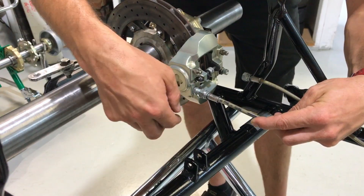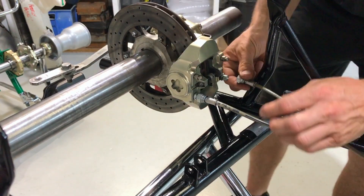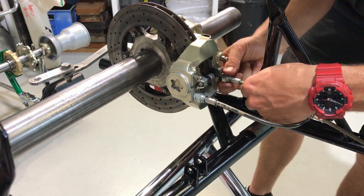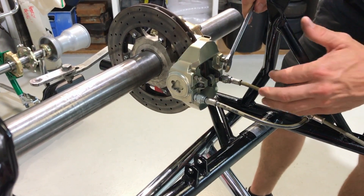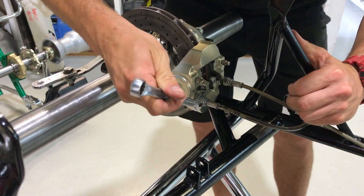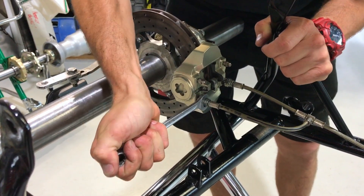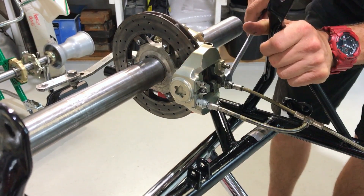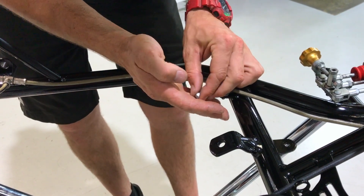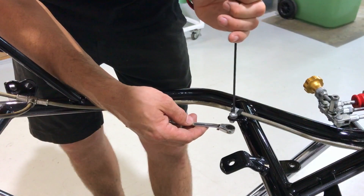Go to the back and push the fitting onto the cart, screwing it on by hand — it goes on pretty easy. Grab your 14mm spanner and lock those off. You do have to do them up pretty tight; you don't want these coming loose and they have a seat that seals the system. Lastly, put the chassis clip through to stop vibrations and do it up with your T-bar.